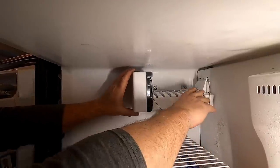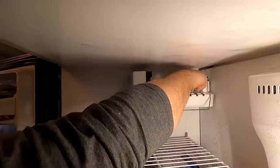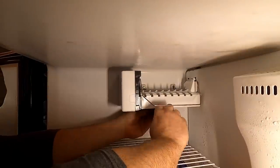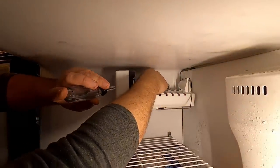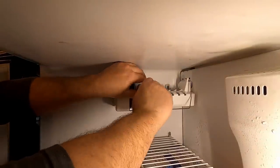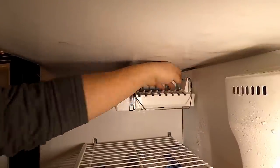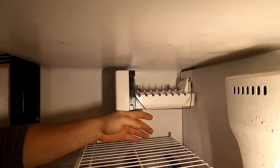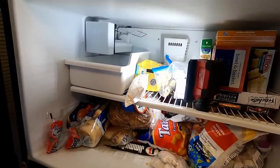There we go. It's almost like you need to know what you're doing. That feels about right. Put that lower screw back in, let's snug these guys up. It's just sheet metal and plastic, so don't go too crazy with the torque here. Spout's over that, plugs in there. It's in there, so you've got to plug it back in and push it back against the wall — do everything we did in reverse, basically.